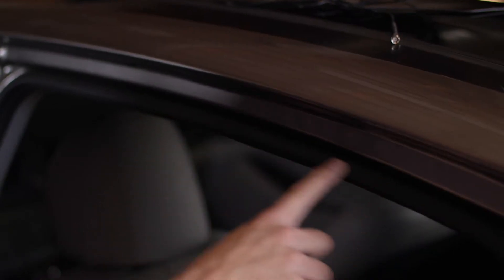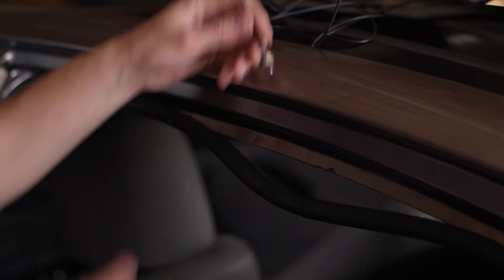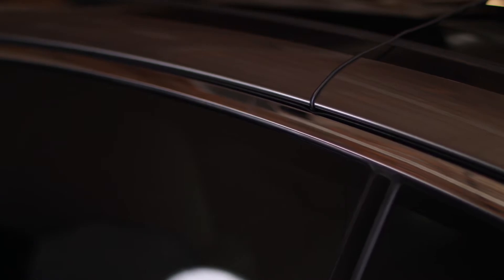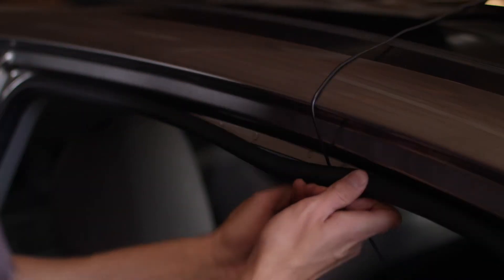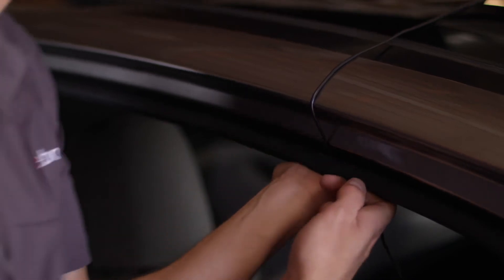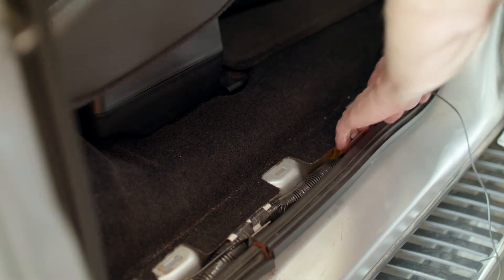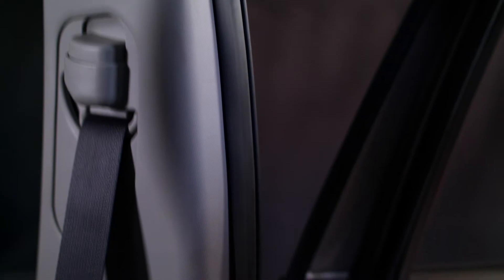With the antenna in place, run the cable to a nearby door. There's a weather seal running around the lip of your door. On most vehicles, this is removable. Simply pull this back an inch or two to create a space and run the cable through. It's totally fine to do this and it simply snaps back into place when you're done. The cable is thin yet strong and designed to be shut in a door. Run the cable through the gap you've created and into the vehicle, then press the weather seal firmly back into place. Now run the cable to where the booster will be installed. For a professional look, remove the paneling and hide the cable beneath it, or tuck the cable behind the lip of your weather seal.